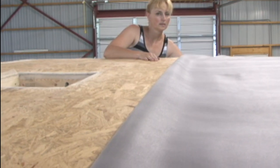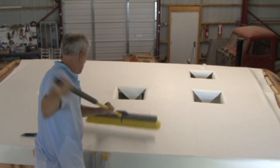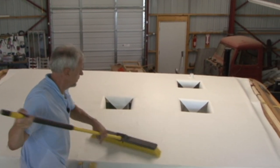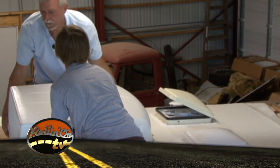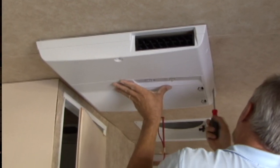Now, fold the other side back and repeat the process. Finish by sweeping out any air bubbles in the roofing membrane, starting in the middle of the roof and working towards the sides. Installing a roof air conditioner is not difficult. You need to make sure and follow all the electrical codes and read all the installation instructions prior to installing the AC unit. With this air conditioner, we have enough cooling power to turn the old trailer into an igloo